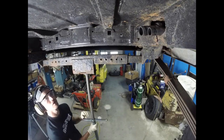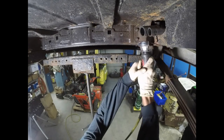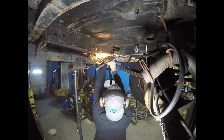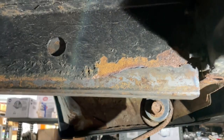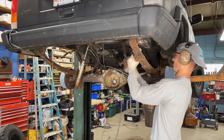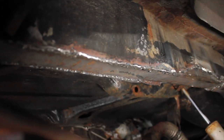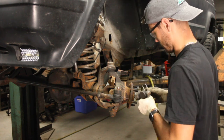The hitch now has to be removed and the unibody needs a major structural repair. What seemed like a simple fix turned into hours of cutting, grinding, bending, fitting, then welding, grinding, more welding, more grinding, and painting the rear underside of the car. This is why people tell you not to buy a Jeep, I think. But I don't listen.